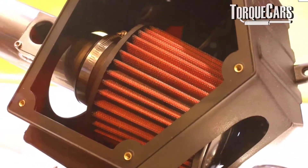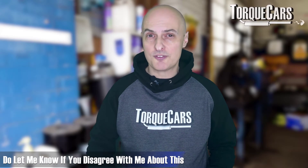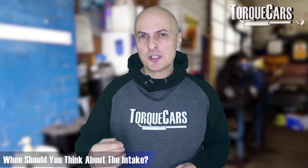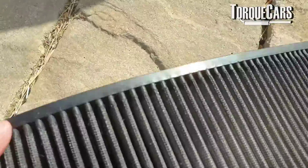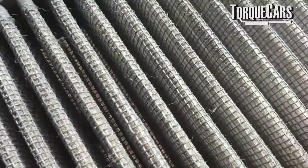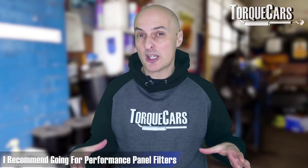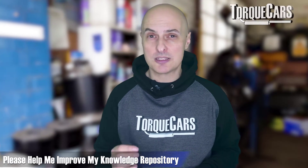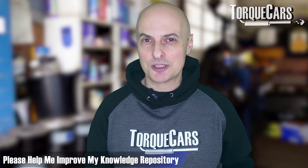A lot of people talk about induction kits on the CRDI engine. If you've done nothing else to your engine, an induction kit won't add substantial power — the stock intake setup flows more than adequately for a stock engine. When you ramp the power up significantly, you'll start to hit a restriction and that's when you need to think about the intake. I would recommend going with a performance panel filter, which replaces the factory paper filter with a higher-flowing cotton gauze type. It'll often give a little more freedom at the top end and help the turbo spool up more quickly.